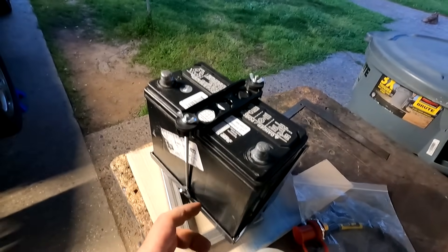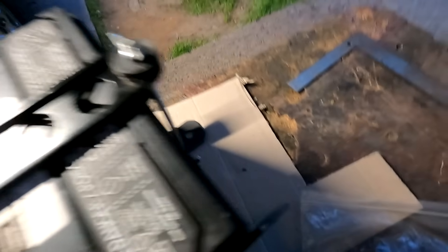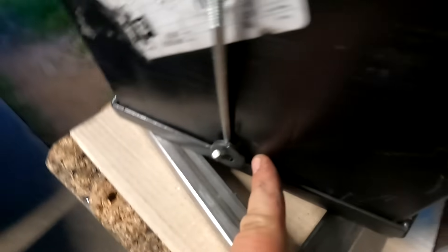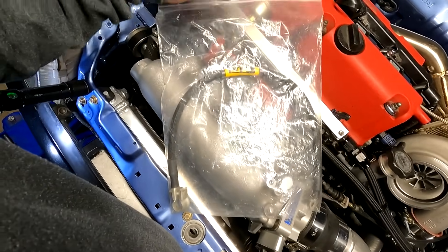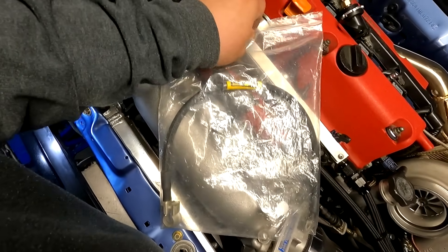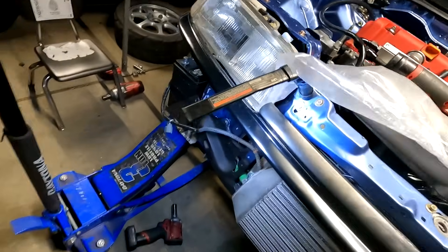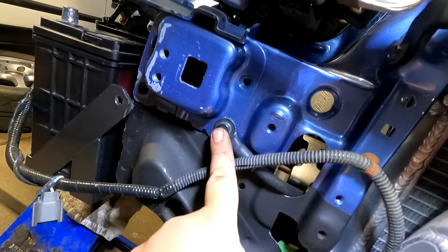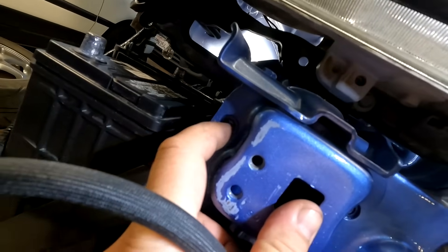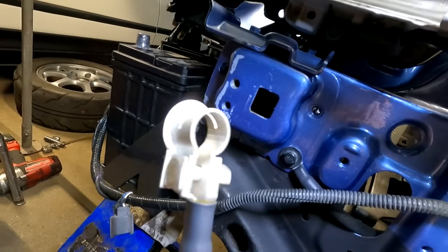We got the battery secured on the bracket and tie-down. It's pretty firm — a little tight on the rod itself, but I think we're going to be okay. Chris, when he sent over the K20 conversion harness from CJS Wiring, he also sent over a ground cable. This is going to be easy for the negative side — it goes onto the battery and I'm going to tie it into the ground that's already on the chassis. This CJS ground strap will run from the frame hole to the post terminal so we don't have a bunch of lines on the battery connection.